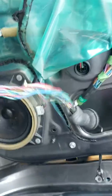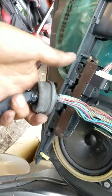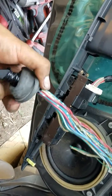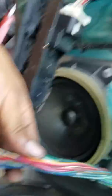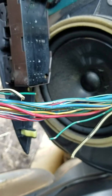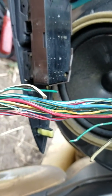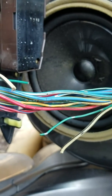I wanted to add a little bit more to the video. I cut off the rubber piece here and pulled it all the way back as far as I can go to expose the entire wiring harness. Getting close, you can see where the issue seems to be happening. It looks like where the door's been opening and closing constantly, that's where the wires have been flexing constantly and eventually they tore.